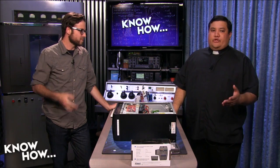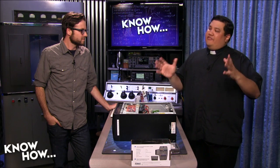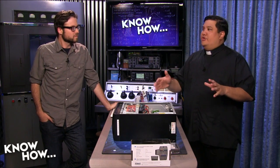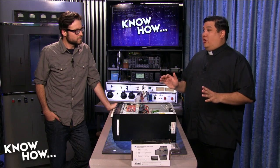So I mean, you don't need a lot of power for this, though. When you're looking at your power budget, you're typically looking at somewhere between 50 and 200 watts for the motherboard and the CPU, and you're not going to put a video card on it. You're also going to be looking at about 30 watts for each hard drive. It doesn't actually use that. Most hard drives will pull somewhere between 5 and 9 watts in operation, 20 while really cranking. But you need 30 because they use more power when they start up.